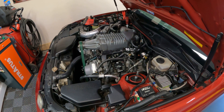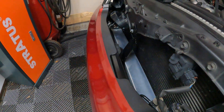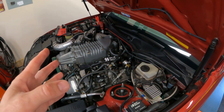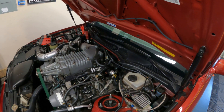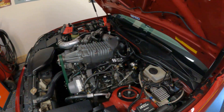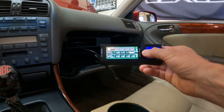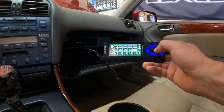If you haven't watched my previous episodes, I have the fuel system set up to run more boost. I have the intercooler, 330 injectors, a Walbro 255 pump, the Split Second enricher, and the Apex'i Neo which is actually leaned out quite a bit — so I have a lot of room to go. I want to show you what my fuel maps look like so we can make an adjustment before we put on the pulley, because I don't want to jump in the car and have it run lean. I'm pulling a percentage of fuel away to maintain roughly 11.5 AFR, and I'll make a change off camera. You'll want to take your tuning system and do the same thing.